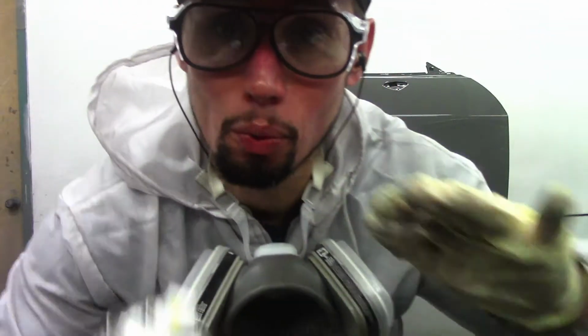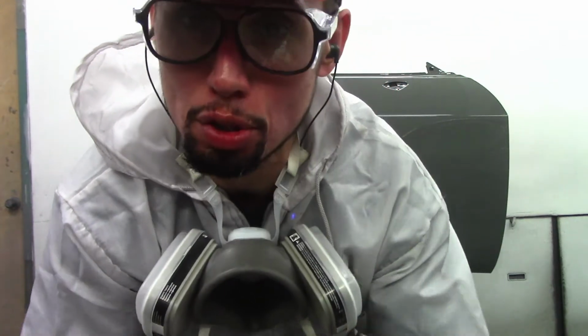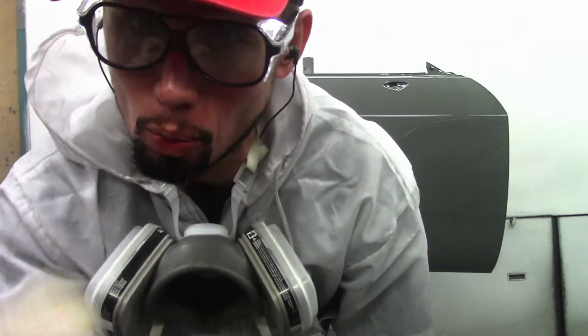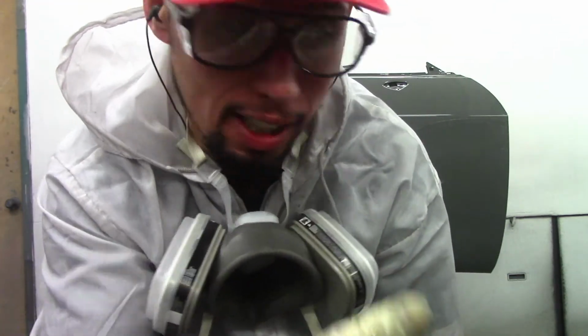When you're done with your quarter panel job, there's always an area that's blended inside of the jambs. Make sure to use a blender, an aerosol blender, or a spray blender that goes in your gun, to melt away the clear that is supposed to be blended into the inside jamb.